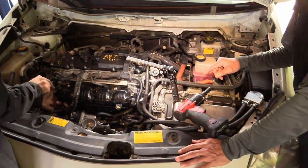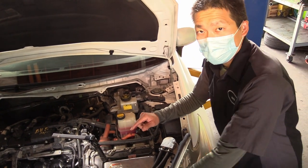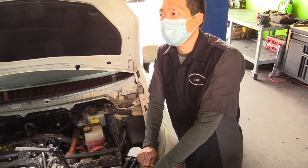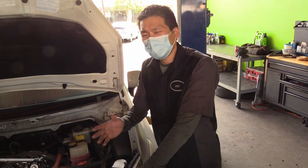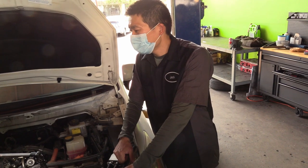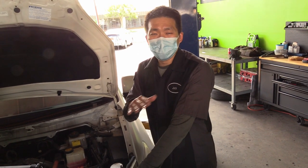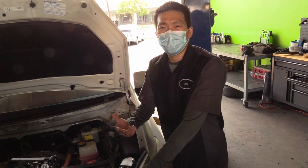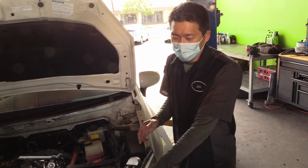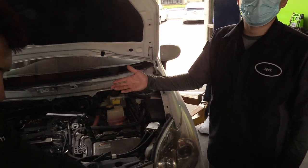So I did some research before doing the engine swap. Basically, you can find a fully rebuilt engine on eBay for like $1,100 to $1,200. So if you are a DIYer, this is potentially something that you can do over the weekend. Alternatively, like I said earlier, you can replace just the head gasket. But a head gasket is just a year or 2 years of driving it very carefully. The overheating problem is still there.